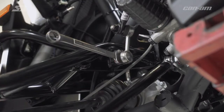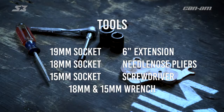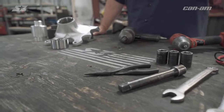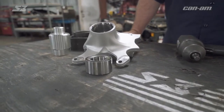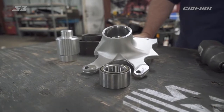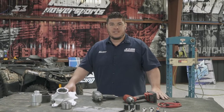Depending on your specific model, the backup wrench on the sway bar might be a little different from year to year. Now with a few simple hand tools you can get this job done. For your socket you're gonna need a 19 millimeter, a 15 millimeter, and an 18 millimeter. You're gonna need a six inch extension, some needle nose pliers, a screwdriver, and an 18 and 15 millimeter wrench. If you want everything to work like it was intended from the factory, we recommend you use the OEM bearing. There are a lot better tolerances and they're gonna last you a lot longer. So let's get the work started and get these bearings in.